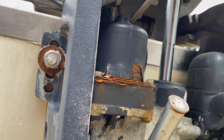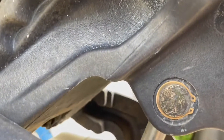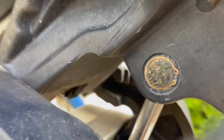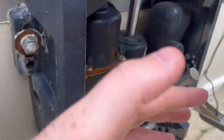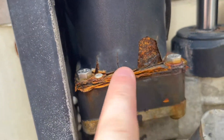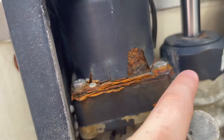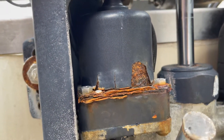In order to do this, we're going to have to take out the tilt pin, which is right here. That'll allow us to slide this whole tilt trim mechanism forward because we need to get to all four screws. There's one right here, one right there, and then there's two in the back. You can get to these three pretty easily, but the one all the way in the back corner — that one you cannot easily get to without tilting this out or taking the motor off. So tilting this out is going to be the easier way to do it.